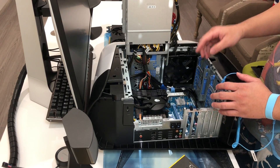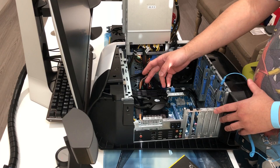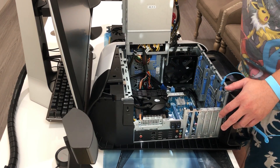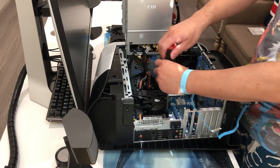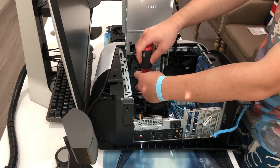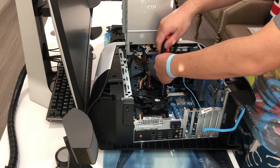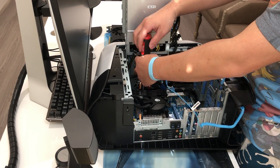The first fan is done and the second one is a little harder because we have to take out the CPU, and maybe the memory and the heat sink, in order to get the radiator out. We also need to take out the top panel to install the extra fan. Grab your screwdriver — make sure you don't drop it otherwise it might break the motherboard. We also want to reapply the thermal paste, which is why we want to take out the CPU, wipe out the old thermal paste, and put on the new stuff. I'll put the link for the thermal paste on Amazon in the description below.